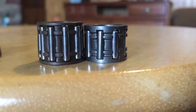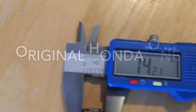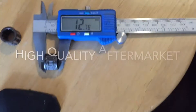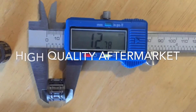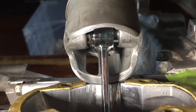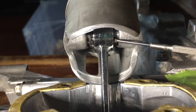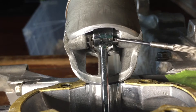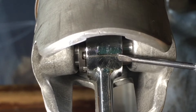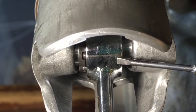The one on the left is the Honda original, the one on the right is the aftermarket. With the aftermarket bearing installed, you can see when I stick in the screwdriver that it isn't actually seated all the way — it doesn't go right up to that spot, so not all of it is on the top part of the connecting rod.